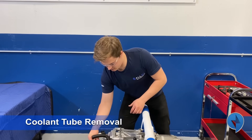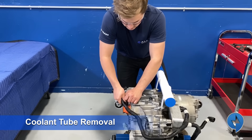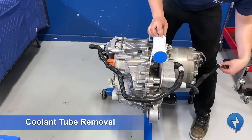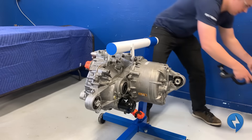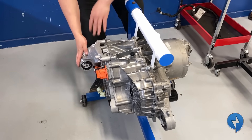There's a little clip — once you pry that with the screwdriver you can pop that off. There are a couple clips, one more down here that's already been removed, and then two bolts. Next up we're going to remove the front left motor mount.